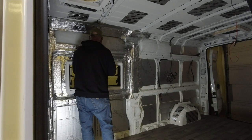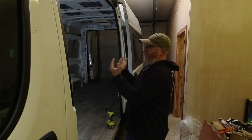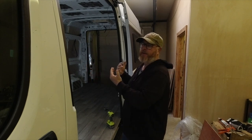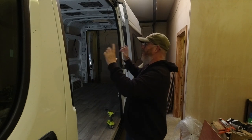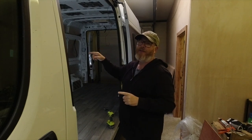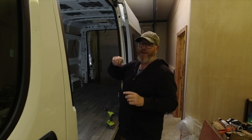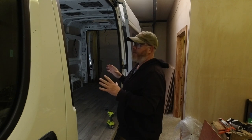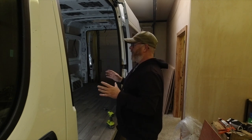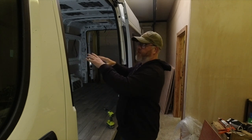I'm just removing the window blinds from the actual windows, because the window blinds sit on the internal side of the internal panels. So when you fit the panel there's more cutting out to do — you fit the panel, then you go on the other side of the window, mark around roughly on the inside of the internal panel where the window is, and then cut that out from the panel.